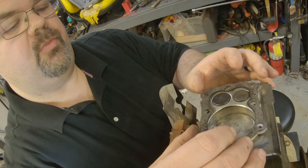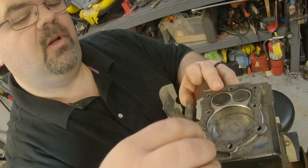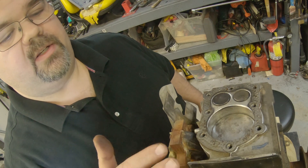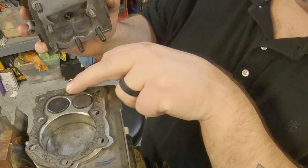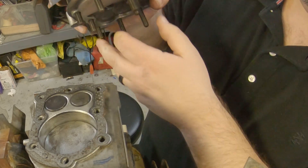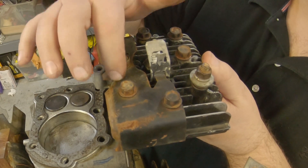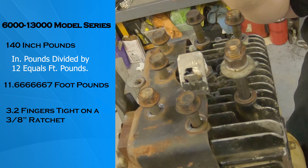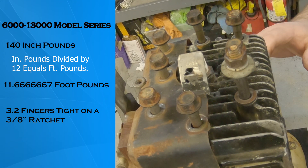When you go to put the head back on, make sure you put your head gasket back on there. I am using the same head gasket I took off — nine times out of 10, unless it's burnt out, blown out, or damaged, you'll have no problems reusing the head gasket. But if you do have a damaged one, they're not that expensive — I would replace it. A couple of things to keep in mind: you've got two longer bolts that go in the exhaust port right here, and this one has a longer bolt back here where it mounts to the bracket. These bolts are different lengths — eight total — and don't forget to put this little plate back on too, that's like an air deflector that helps keep heat away from the head. The torque setting on these head bolts is 12 foot-pounds — you don't want to over-tighten them.